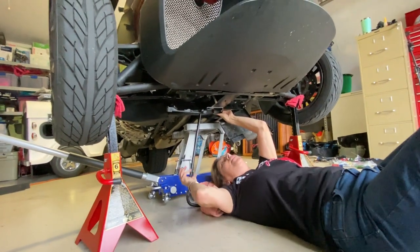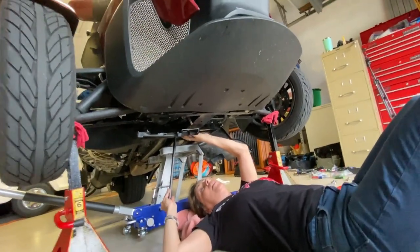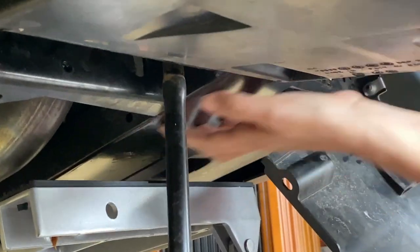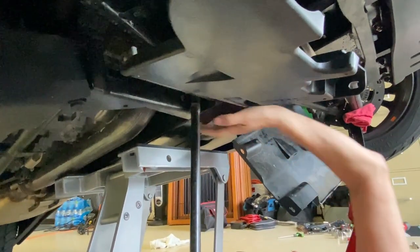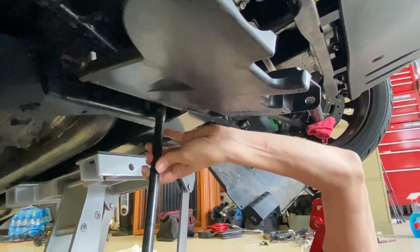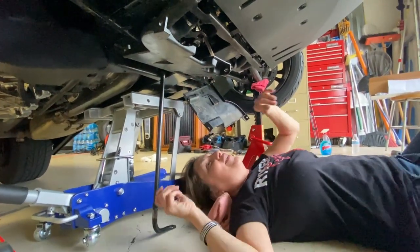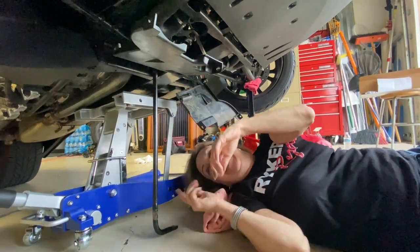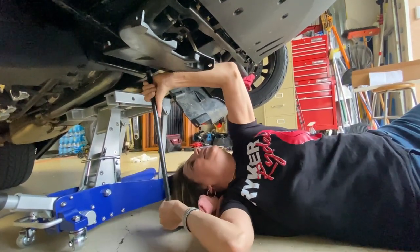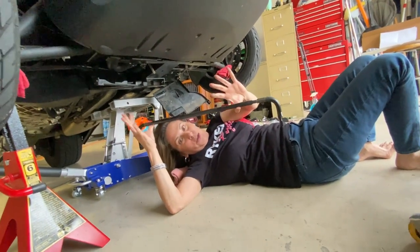This is the reason why you need 24 inches — you need that exact angle to get the bar around the bottom part of the frame of the bike. This support piece is where your jack point is, on the frame. The bar needs to come around this turn, and that's why you need the bike at 24 inches. Even 23 and a half inches can work. This is the old sway bar — next we're going to put in the new one.